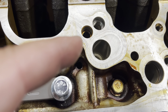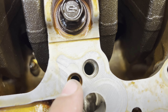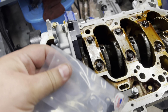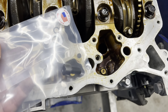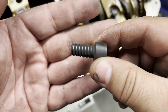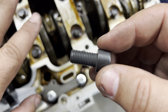I'll use this plug to block off the oil jet that splashes oil on the balance shafts, because on the Z3 and Z7 that's not threaded — it really just depends on the girdle. On A2 and A4 those are threaded, but on the Z3/Z7 it's not. This saddle plug will go in there. I cleaned it with brake cleaner and I'm going to Loctite it so it never comes out.